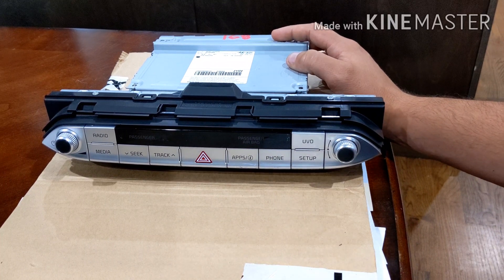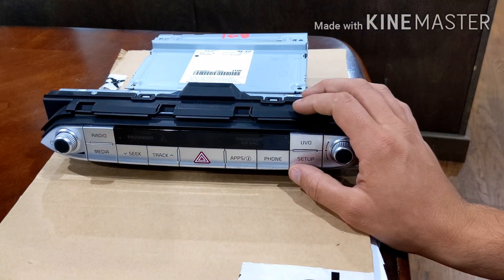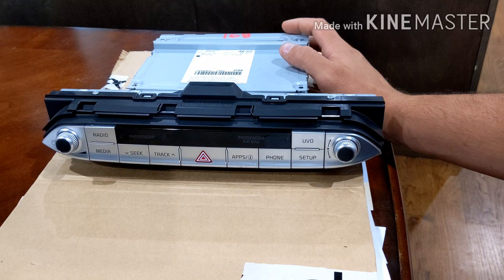I'll take some high quality pictures and post them — maybe somebody will be able to figure out things that are missing. I'm assuming the cellular modem is just not installed, so that was my main reason for opening it: to see the possibility of installing the modem, or anything else. I was also hoping to find a way to program the firmware myself, since all of these buttons other than the reset button are software buttons, so none of them can register with Android to bring it into recovery mode.